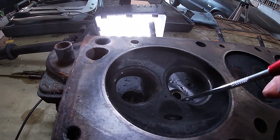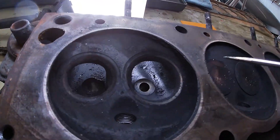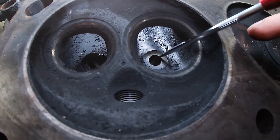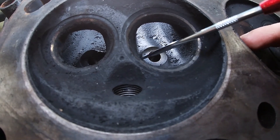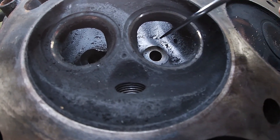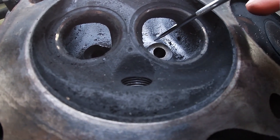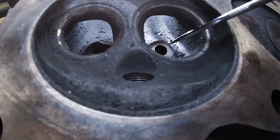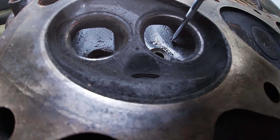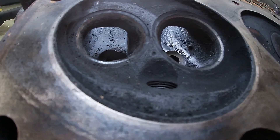Around this side it doesn't look all that bad, I may just do a cleanup. Around here there's nothing really all that bad, but mainly that lip right there is what I'm going to touch. Now if we look down into the bowl by the valve guide, we have this casting where they just spot-faced it right here. That can be radiused out and just smoothed out, that sharp edge - just put a radius on this. Porting, you would actually go in and shape this, but I'm just going to clean it up, maybe do a texture on here, and leave it alone. There's some casting gunk down in here - I'll take that out. No need to have that in there.